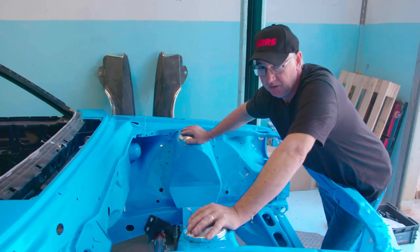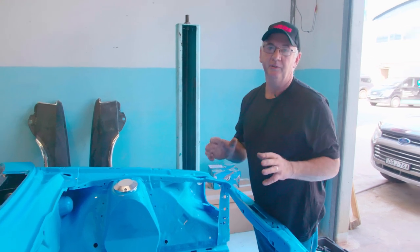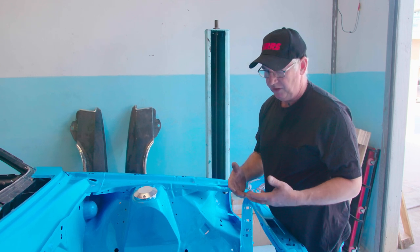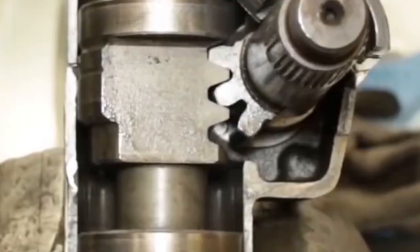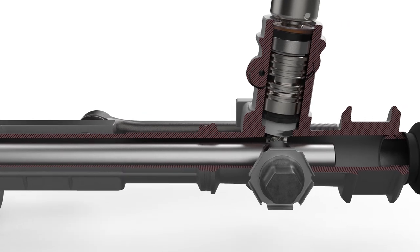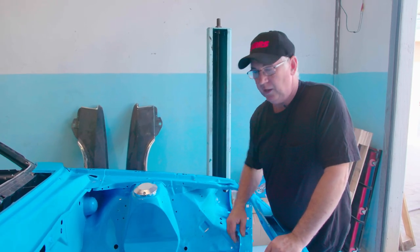The very first thing to mention is it's a replacement for a steering box or a ram power steering system. All of those were the best you could get in their day, but not anymore. The conventional power steer box has a worm and sector shaft that, as you move off the center line, comes out of mesh. A rack and pinion is constant mesh, so no matter where you are, you're not getting free play in the steering.